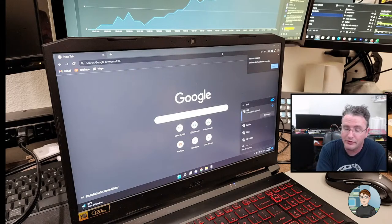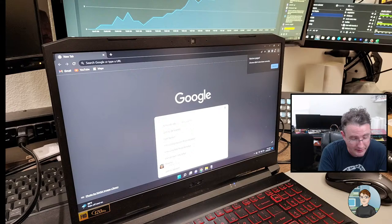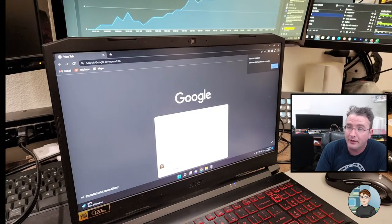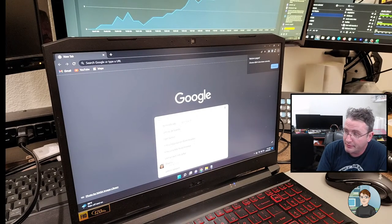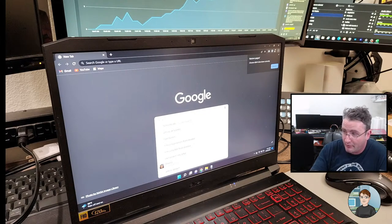That does happen quite a bit, Zulu. People will tell me something's happening at their house, and I get it over here, and it doesn't happen. It usually means that the problem is at their house, something they've got connected at their house. But occasionally, if a computer won't turn on, and it's a desktop computer especially, if they move it into their car, they bounce it around town getting it to me, I move it in here and plug it in, and it works, chances are it's just a slightly loose component that got jostled around just enough to get put back into place well enough to work. And in that case, I open them up and just redo all the connections, just take them out, put them back in real quick.